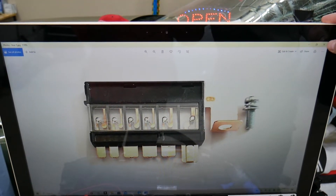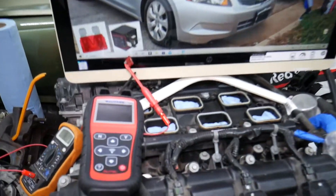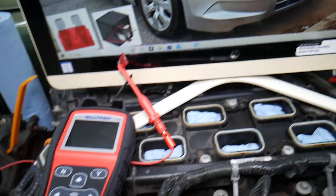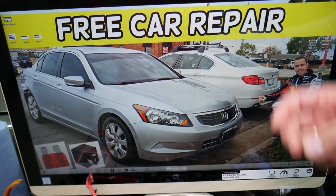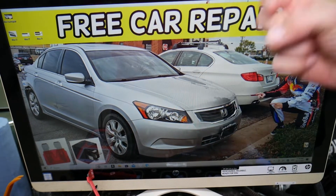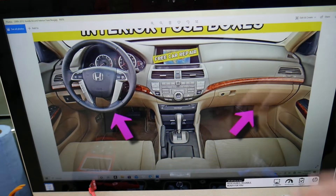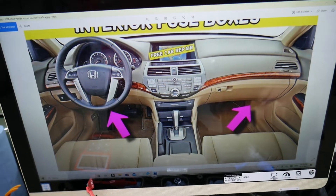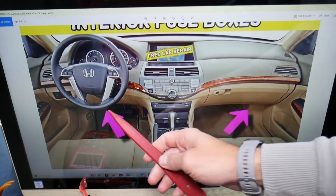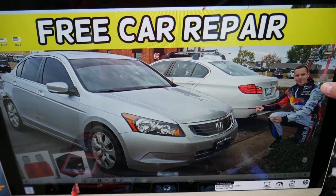So, the TPMS fuse — where is it located? We're going to demonstrate on a 2010 Honda Accord. You guys have three different fuse boxes in it, but luckily we'll only be working in one of them. It's located in the interior of your car, under the dash on the driver's side above the pedals. Come under the dash and look all the way upside down — you're going to see a fuse box layout that looks just like this one here.